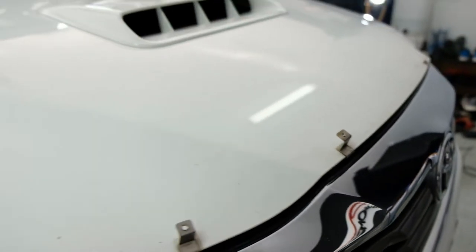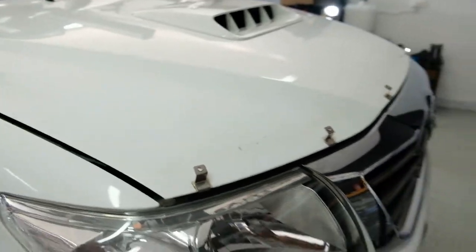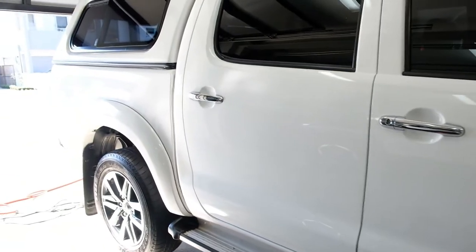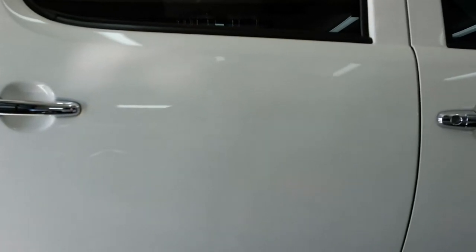Yeah, so the bottom protector's off. Gain full access. Takes 2 seconds, take it off, up around it, see you later. All this side's done, we're looking super shiny now. Solid paint, so pretty easy to correct. On a single stage, we're getting about 85-90% correction, which is more than what the customer expected. With the light on, you can barely see anything other than some deeper stuff that won't come out with a single pass.